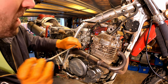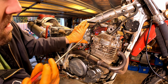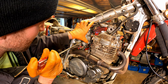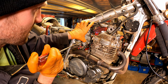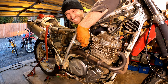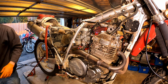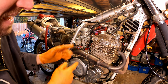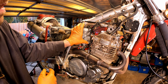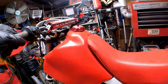It won't rev up at all. I'm tapping the carb in case the slide's stuck. I think it's safe to say it's carburetor clean time. That's how you clean the carburetor quickly — you rev it up and cover the intake, it'll suck everything through the jets and any little gel in there. Let's see how she is now. Oh yeah! I'm sure my neighbors hate me by now. Let's take it for a ride.